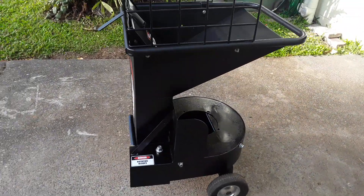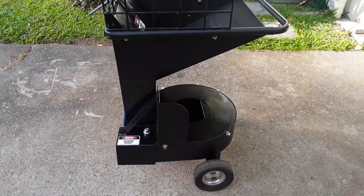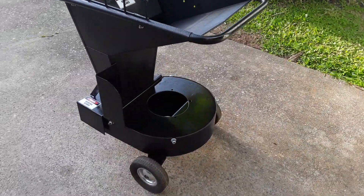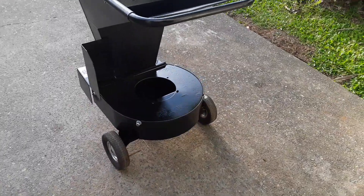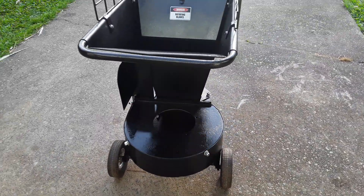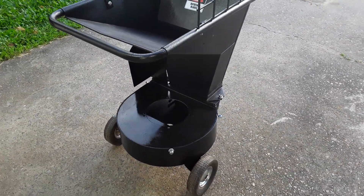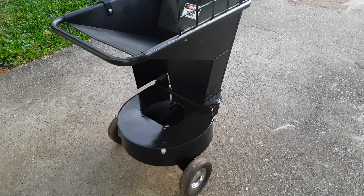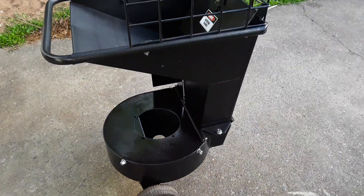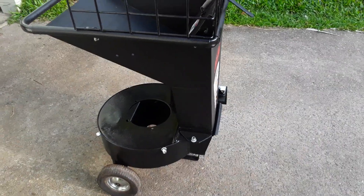All the metal is thick — there was no actual rust-through, just a little surface rust. So I took it right back, sandblasted every component back to bare metal, then applied two coats of Raptor primer, let that go off, gave it a light sand, then two coats of Raptor 2K paint and two coats of clear. I think it turned out pretty well actually.